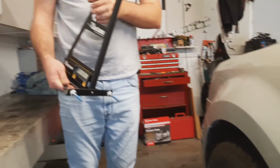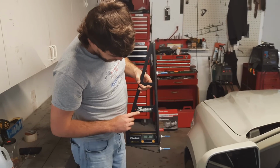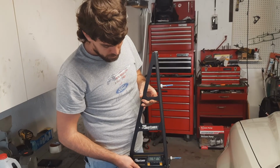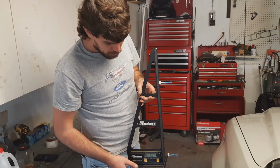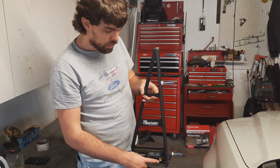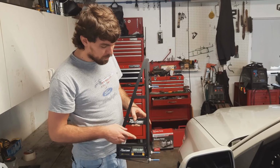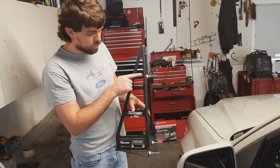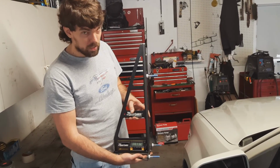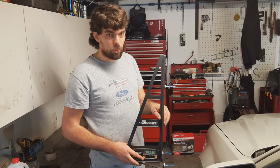And where do you get something like this gauge? So I ordered it online. Watkins Smart Camber 2 is the tool itself. Watkins is probably the name of the company, but Google search Smart Camber and you'll find this tool, and it will come with the whole fixture and the digital gauge. That digital gauge is real nice. I think the standard gauge would come with just this upright plate and two of the pads that touch the wheel. And then I bought the additional lower plate that gives you 3 points of contact to give you a little bit more stable contact with the wheel. That's a good idea.